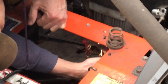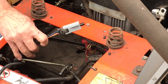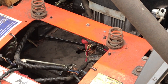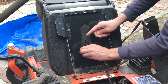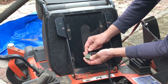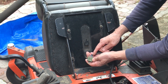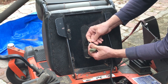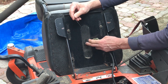Oh yeah, we're good — it turns over. That tells me the starter and solenoid are fine. We've already checked this switch, so I don't think it's that arm. It's real common for seat switches to go bad, so I'm gonna check that next. The seat switch is underneath the seat — pull this little tab up, wiggle it and disconnect it. We've got a black wire which is ground, and the switch wires are the blue and green. I'll take a paper clip and bypass those to complete the circuit.